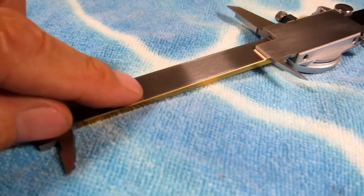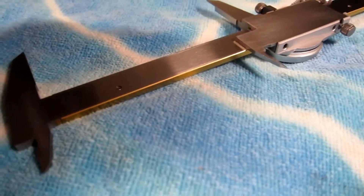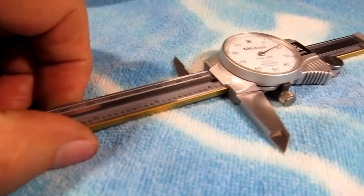There's three of them and there's some clearance. So put them in, wiggle them into place. Don't tighten one and then put the next one. Leave them a little bit loose and tighten them down gradually. But come in here and push that against that back wall. That's important.